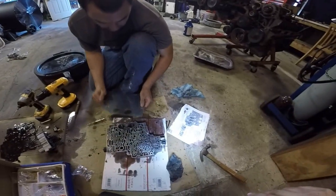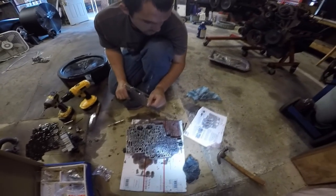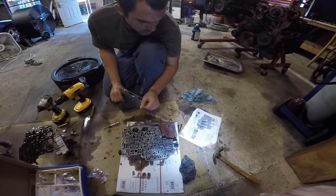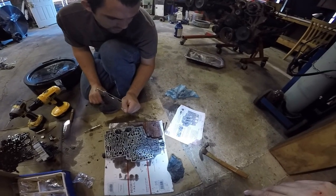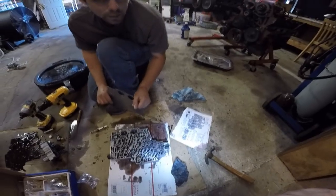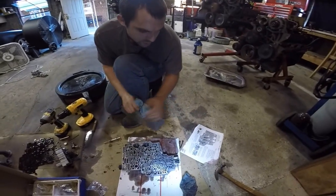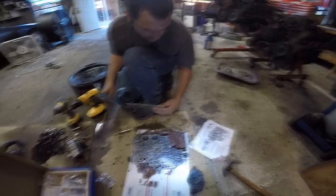So that's why, because we keep overdoing it. I think on one car we drilled 145 into it. I think so. Just for fun, and I don't think we really noticed much of a difference. No, I think you only noticed it in Corey's truck because it was a leaf spring rear. Okay. I think that's why it seemed as violent as it did. When we put those traction bars on, it shifted perfectly smooth. So I think it was actually the leaf springs, axle wrap, thudding the car around.